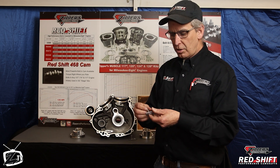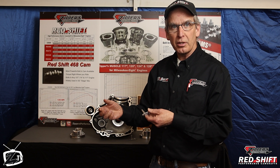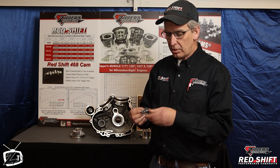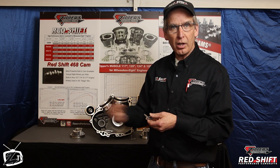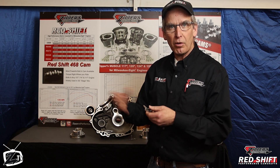As you'll see in a test that we're getting ready to roll out, you're going to see the difference of an oil jet that actually opens and closes at the proper pressure but has a very serious restriction — something lodged up in one of the jets that you can't see. This test will demonstrate the flow rates of one piston jet versus the other.